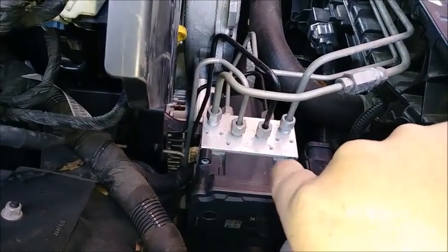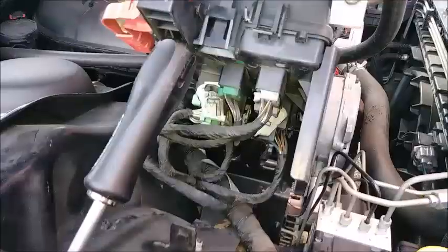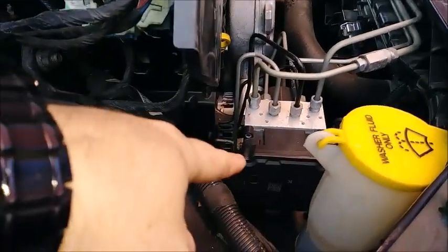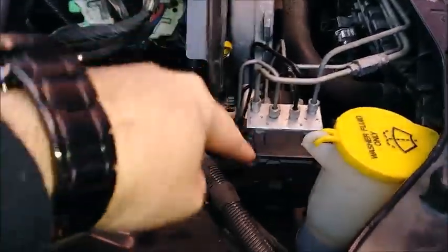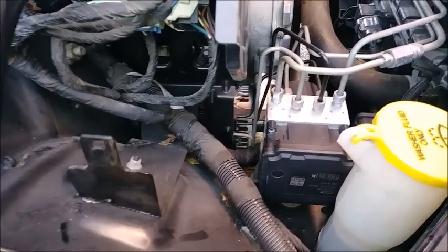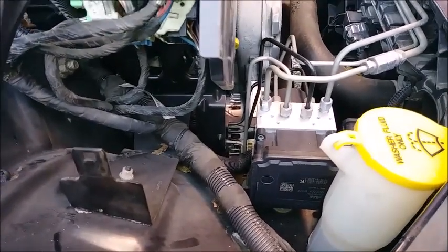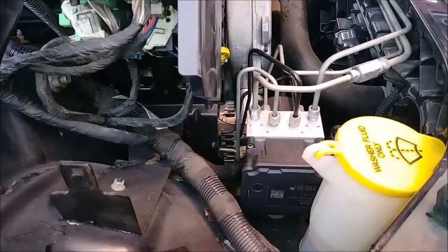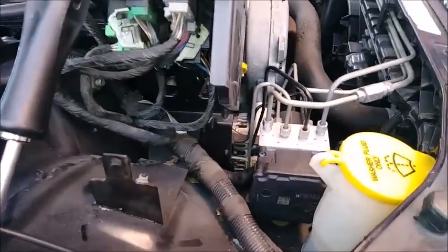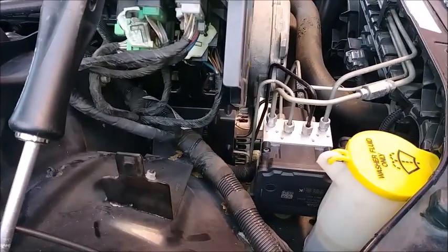There are four T20s, one at each corner. You're going to have to get your fuses out of the way too. Just unclip it and that pops up. I got it kind of propped up with a screwdriver so you can get your hands in here and T20 those off. Once this box comes off, you'll be able to put the new one on, scan for codes, and then the meat of the video is going to be showing you how to re-initialize the new module so the car will recognize it, get rid of your codes, and you'll have ABS, traction, and all your goodies again.